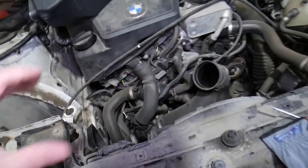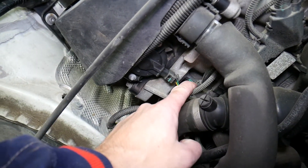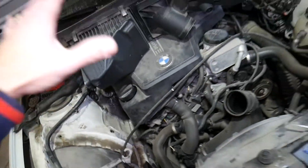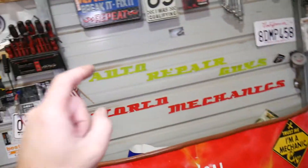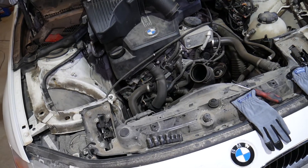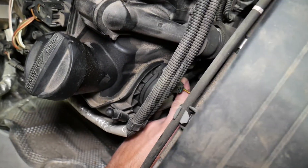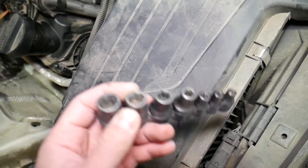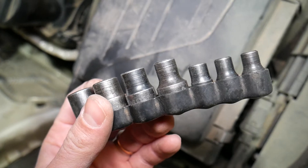It looks like this one on the intake side — it has only one bolt. I went ahead and removed the air filter box so I can show you the exhaust camshaft position sensor, and it is right here. If you need to see how to remove the air filter box to gain more room, we'll have that video on our main channel, Auto Repair Guys. All you have to do is remove one bolt to remove the exhaust camshaft position sensor. You'll need a female or reverse torx — we'll have those listed in the description as well.